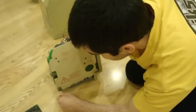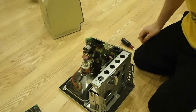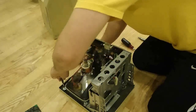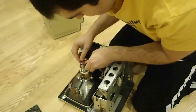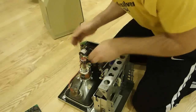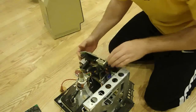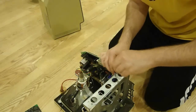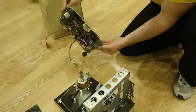Remove the cap using pliers — get in there and pinch it, and it should come out with ease. With the machine safely discharged, remove the three screws on the side of the analog board, then remove the wire that crosses over the back of the CRT. Carefully remove the neck board — if you crack that tube it's game over. Remove all the screws and here we are: a nice, usable analog board.